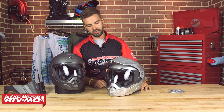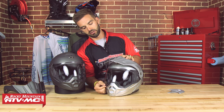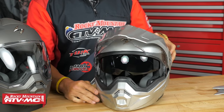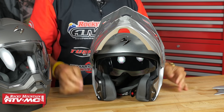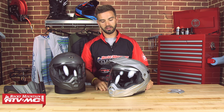Underneath the visor, let's talk about the shield. You get a polycarbonate shield that is optically correct, meaning the curvature won't distort any images or your vision as you look through it. At the bottom there are two tabs, one on each side, so no matter which hand you use it's easy to get the shield up. You get three detent positions — partially open or all the way up. There's also a nice big weather gasket going all the way around the eye port. On the side you'll see a black mechanism — pull that back and it drops down an internal sun visor, which is very convenient. You can even have the chin bar up with the sun visor down. Both the shield and the drop-down sun visor have Scorpion's Everclear anti-fog coating already applied.